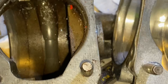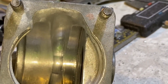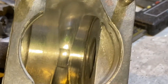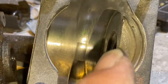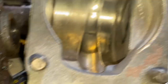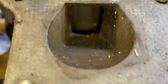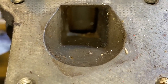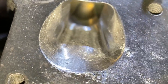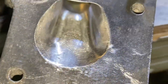Let me zoom in — I think it'll give you a better view. See how smooth that is on this side. This edge here I will round over, but I'm just going to get rid of the sharp corner — I'm not going to take a whole lot off. There's your factory intake — nice square shape, sharp. I get in there and just however big the flap disc takes it is how much I take out. On these intakes I don't use a grinding wheel; I do everything 100% by the flap disc.